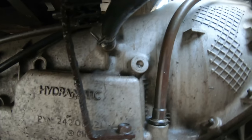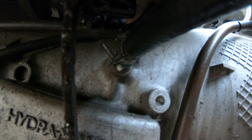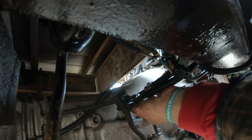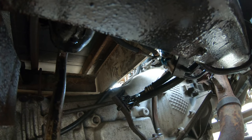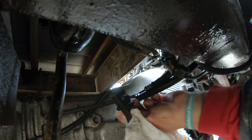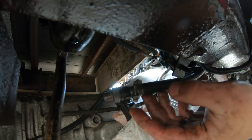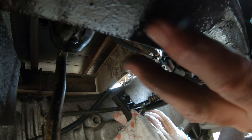So this is the one we're after right here. There are two lines — the line in the back of the transmission is the return line, and the one with the clamp on it is the feed. That is the one we're after. There's my line, and there's my road fix — it held. I was just pulling on it and it held pretty good, but can't take that chance of this truck burning up. You can see all the fluid here.